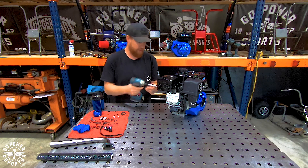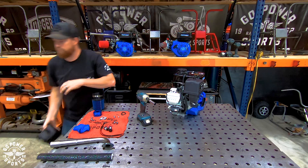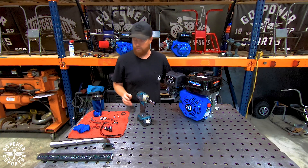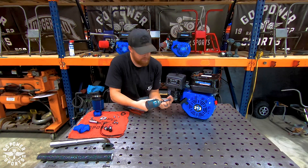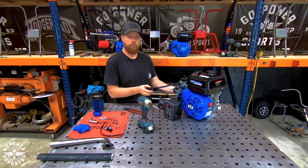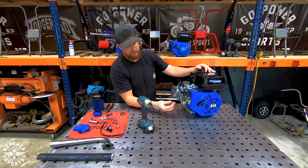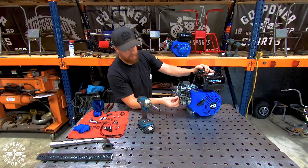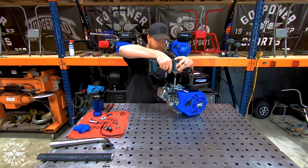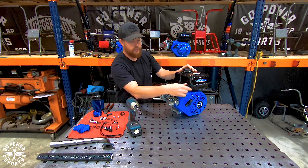This is a 13 millimeter socket. The first thing I do is cut this fuel tank vent, then we will go around to the air box. On these Tillotsons they have a little EPA box on the bottom — we'll remove that as well. This valve cover vent, I'll typically just cut it right after the first 90 and point it down. While we're here we might as well loosen your throttle bracket and make sure that's free.